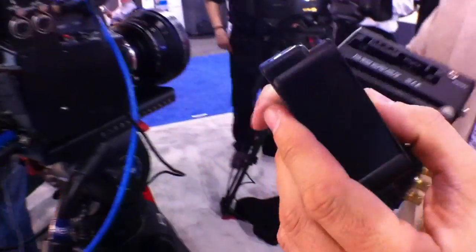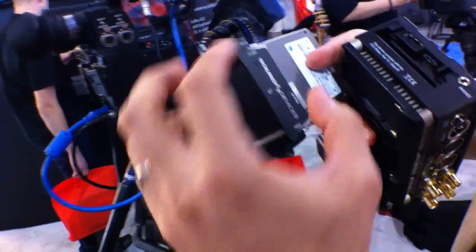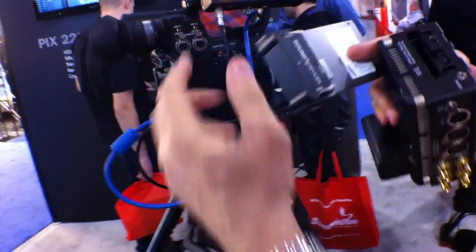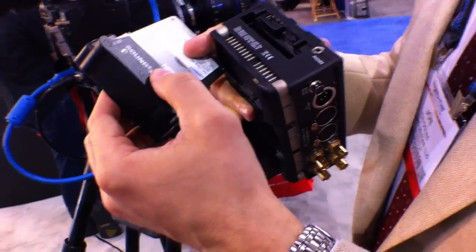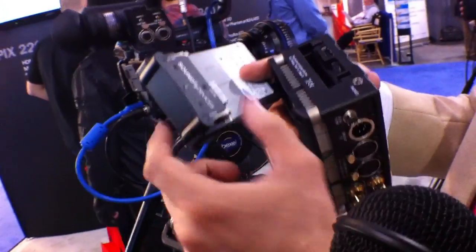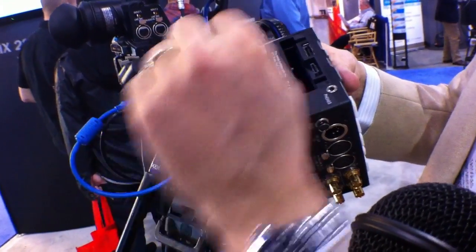What part of the casing is you and what part is the off-the-shelf SSD drive? This caddy — this component on the end — is our accessory. It's the interface that connects from the SATA connection through to the eSATA port; the connection from the device is over SATA. This interface is ours, and it also gives you USB 3, USB 2, and FireWire 800 connectivity. As for swapping SSD drives, you certainly don't have to purchase multiple caddies — they're about $100 each — but you can remove two screws, mount a new drive, and off you go.